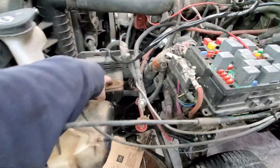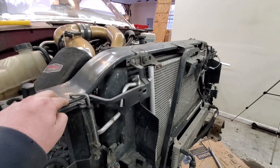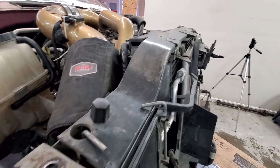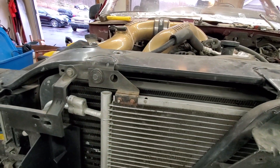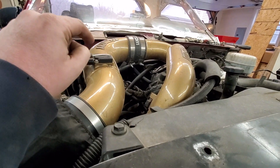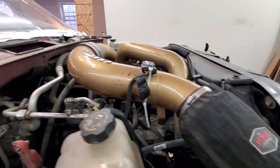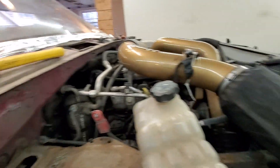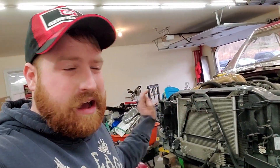This side is definitely more in-depth than the other side because you've got to take the one off here, which was already broken. There are four bolts in the fuse box — you've got the two here, but to get the fuse box out you've got to take off both sides of the brace that comes along here, plus your two back here, and your battery tray. I'm really thinking about painting this probably body color, unless somebody has a better idea. I really like that blue on the other truck in the video — it looked so sharp. I think we've got to paint that too. I don't know — the brown doesn't really work, at least for me. It doesn't look as good with the red. So I think we're going to wrap it up here. That is it for me. Next video should be more of the other donor. Thanks for watching guys, please like, subscribe, share. Have a great day.